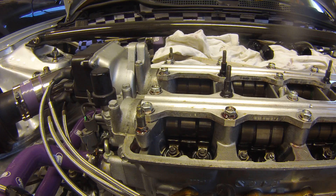Now moving to the intake side, which is a little different. For this motor I removed the driver-side wheel to access the crank pulley, used a 19mm socket on the crank pulley to turn the engine over. Make sure your socket is set to reverse, since the B18C1 rotates counterclockwise versus clockwise.